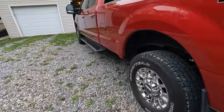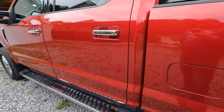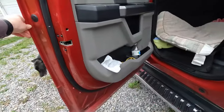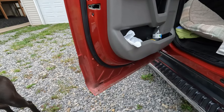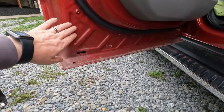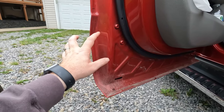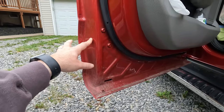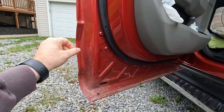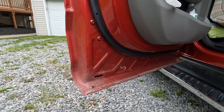The reason I chose not to have the body done - and I'm looking for your comments down below on if you think I'm right or wrong on this, constructive criticism is welcome - my thought was: the places that I see aluminum start to corrode are the places that have a stone chip or something happened to that paint-sealed coating over top of the aluminum. What I didn't want to happen was to have the garage drill holes in the door or the tailgate and have that be a point where the paint is no longer sealed over that aluminum. It creates an opportunity for moisture to get in there and actually starts corroding from that point out. Maybe the oil spray would keep that from happening - that's where I'm looking for your comments.